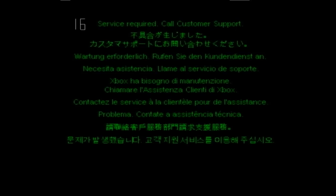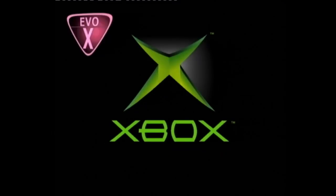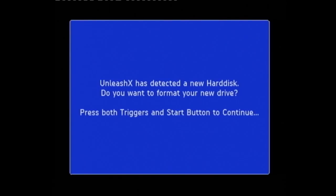So to do that, as we showed you in the last step, we had the Hexen 2017 disk. Download that — the link is in the description. Burn it to a DVD and pop it in your disc drive. Power the machine down; the tray will close of its own accord. We're going to boot our console now to our modded BIOS — the EVO-X BIOS. This is with the chip enabled, which will enable us to actually boot into the Hexen disk. Without the mod chip or this EVO-X BIOS mode, you'll be stuck. That's why you need the chip or the TSOP mod.